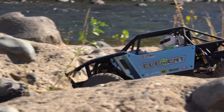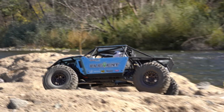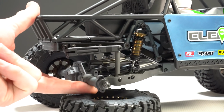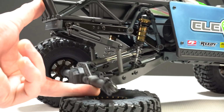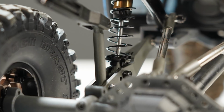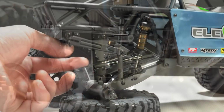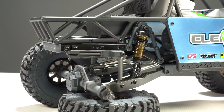There are a few key things, but the biggest is the new Gatekeeper Suspension Package, or GKS, which reconfigures the whole rear end of the vehicle so you still have your standard rear axle back there, but with a trailing arm suspension setup. So this setup moves the shocks more inboard, using a new shock tower and securing the shock directly to the trailing arm, not the axle. The Gatekeeper then also features a rear anti-sway bar that mounts directly to the frame rails and then connects to the suspension on those same trailing arms.